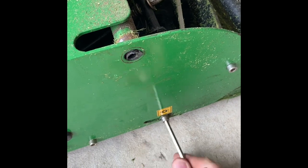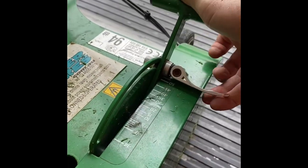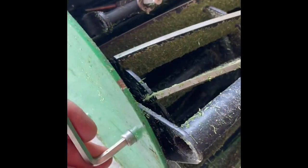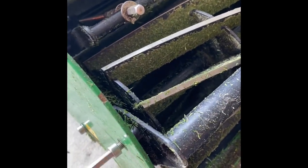Here we are again doing a bit more maintenance on the Swardman. I wasn't expecting to pull the reel out so quickly. Just remember when you're pulling the reel out: undo the height adjuster retaining bolt and raise the height adjuster to the higher side, take the cover off, undo the bolts on the left hand side and the right hand side as I'm showing now.